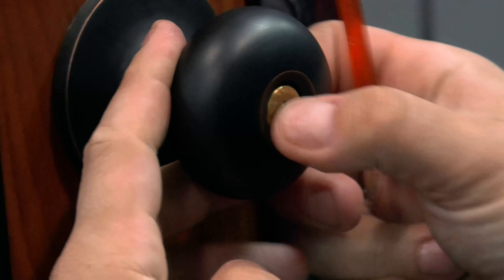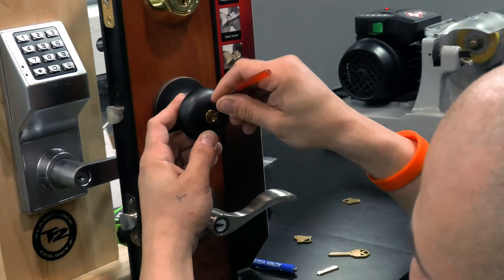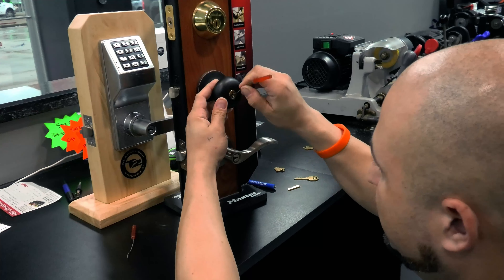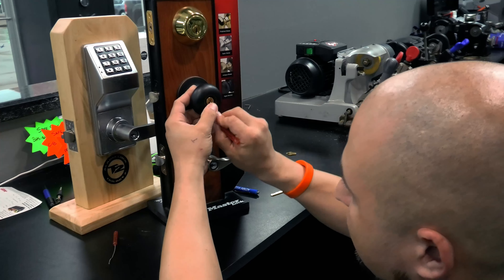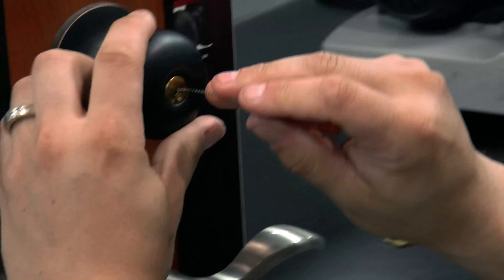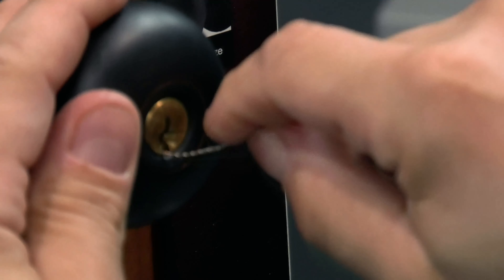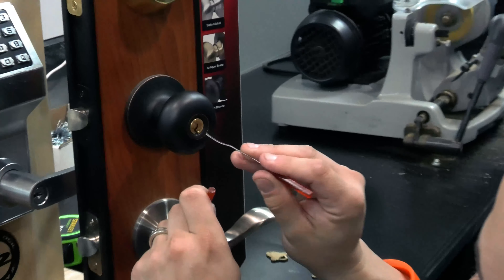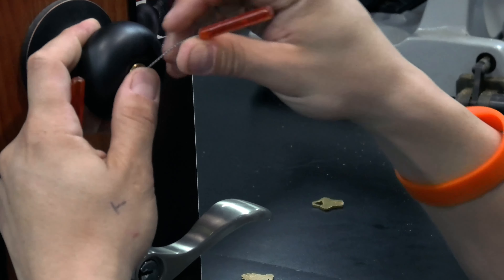Let me try it again. I can go down and out, push it back in to go over it, bounce the pins out of the way, and try pulling up and out or down and out. I think down and out works better because it's pulling against the key — that's how I pulled it out a moment ago. I'm jamming the extractor between the pins, shaking up and down, getting it in as far as I can, then pulling down and out. I'm having a hard time getting it out now, which is good — I want you to see some of the issues you run across.